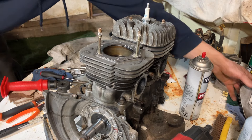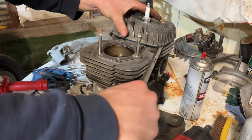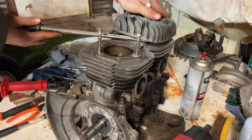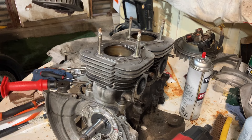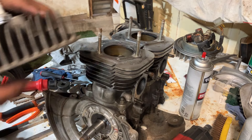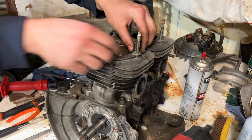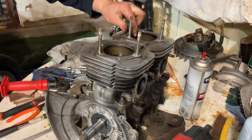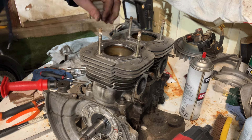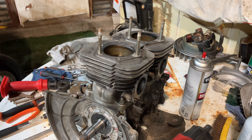I always like to keep them on the same side I took them out — just my rule of thumb. She was sealed real nice. The EX marking tells you which way to put the head back on if you forget, so your top holes orient the right way for the fan shroud. These gaskets were definitely replaced. I can see they didn't do much in terms of the bore on top — it still has a ridge yet. So I'll take a deglazer to the cylinders and get that ridge off, just give it a little fresh crosshatch.